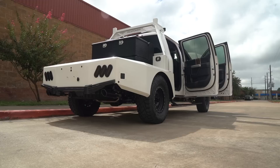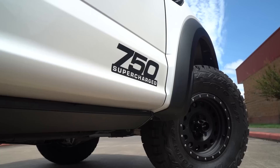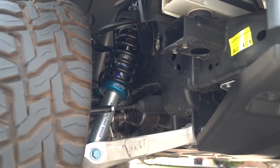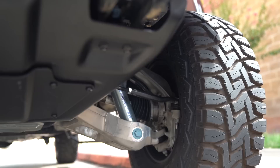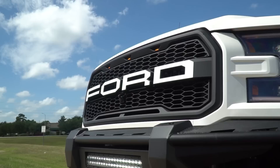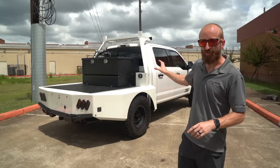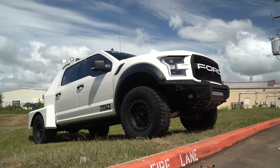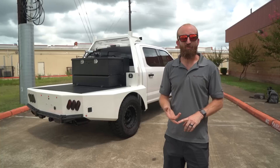Now at the back of the truck, you'll notice the stance and shape of the body. That's what makes a Raptor a Raptor — the flared body panels that are about three and a half inches wider than stock, and you can see we're using those on this truck. Our Raptor suspension conversion uses all OEM parts: upper and lower control arms, Raptor shocks with internal bypass technology, longer brake lines, longer axles, Raptor leaf springs in the rear, all the perches, and the rear shocks. That's what allows this Raptor to go off-road, have excellent on-road ride capability, and just be a great all-around truck.